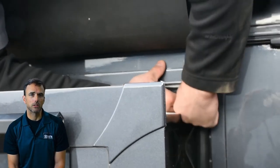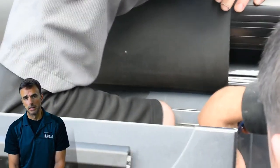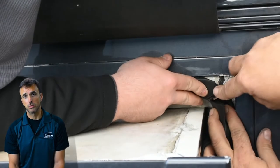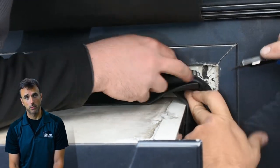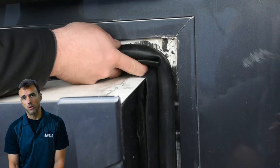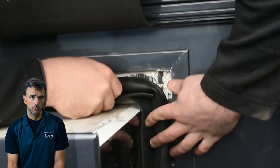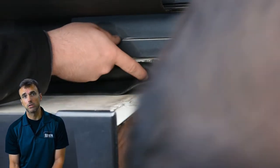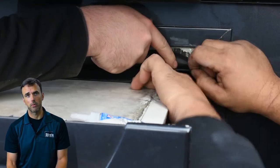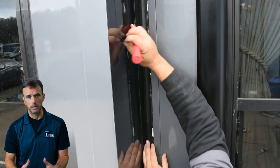Take your time. What you're seeing Greg do is a technique called mitering. With this push-on seal, he's actually wrapped the corner completely with the push-on component, so the bulb and the trim remain intact. He's simply provided a slight cut into the wiper blade itself and is doing some overlap — the flap or wiper on the top section overlapping the vertical piece on the side. Following this mitering technique, he's going to apply our Superbonder 495 to adhere the two wipers together to make it a single piece. This is important because as the slide-out wiper activates and does a wiping process on the side of the slide-out, it'll do it as an integral single piece.